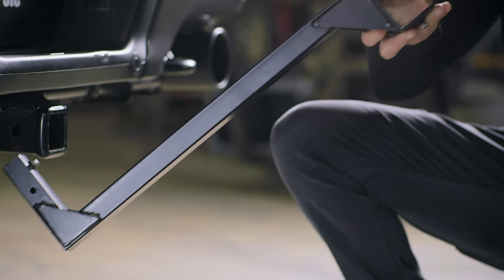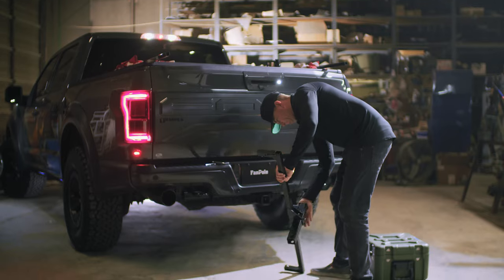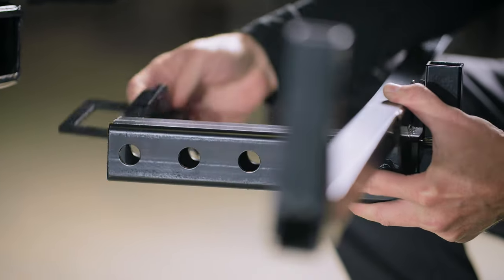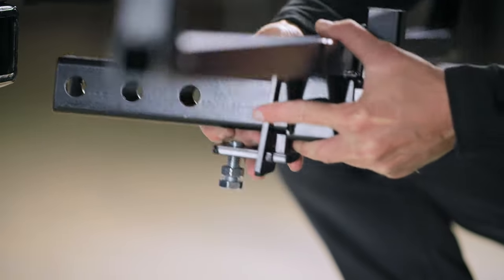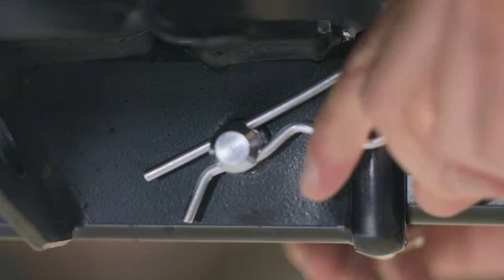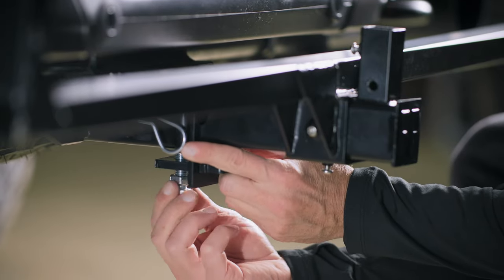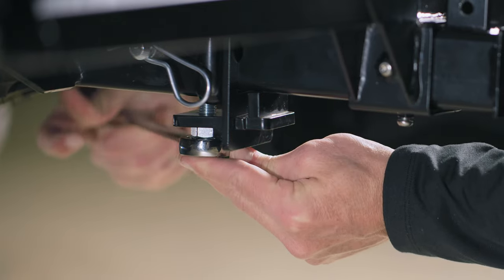The special base for the Double Barrel will look like this. To install it, slide it onto the dummy hitch and make sure the Double Barrel slides all the way to the end of it. Then slide the hitch tightener onto your dummy hitch. Put it into your hitch receiver and lock it into place with the large hitch pin and clip. Slide the hitch tightener up against the hitch receiver and hand tighten the bolt. Use a ¾ inch socket on a ratchet to tighten until all give has been taken out of the hitch.